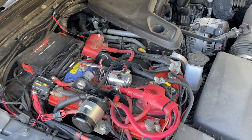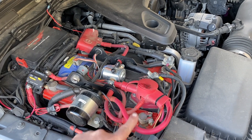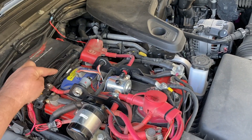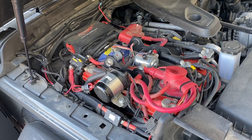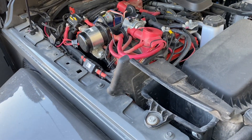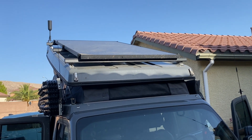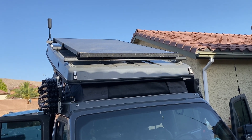It's got a whole bunch of mishmash of wires here. I've got the two batteries here. I have my 100 amp circuit breaker. This cable here is going through the firewall and into the back, and I'll show you where that goes. My batteries are first being charged by my big solar panel up on top — a 430 watt single solar panel.